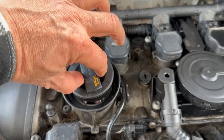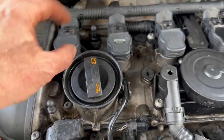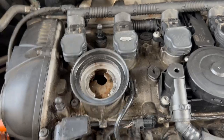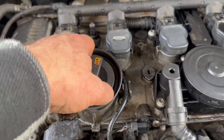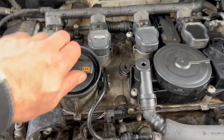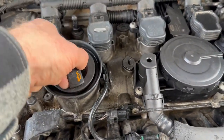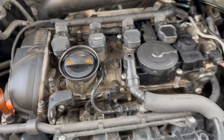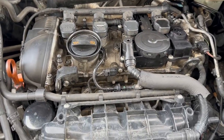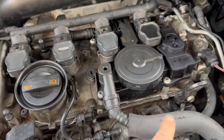You check if this is good by opening this cap — you can see how it sucks it in, it's got a little vacuum pressure. But when I open it and close it the engine runs insane, that's not a good sign. Normally when I open it, it's supposed to start running rough; when I close it, it's supposed to run great. This means it's stuck somewhere.